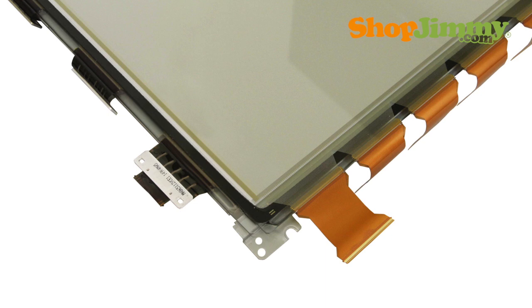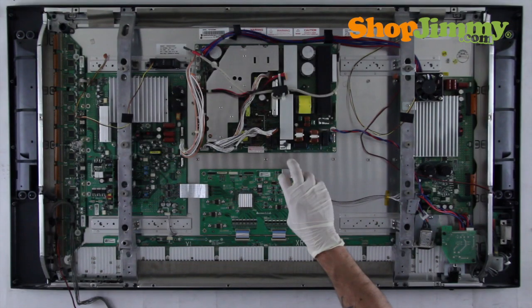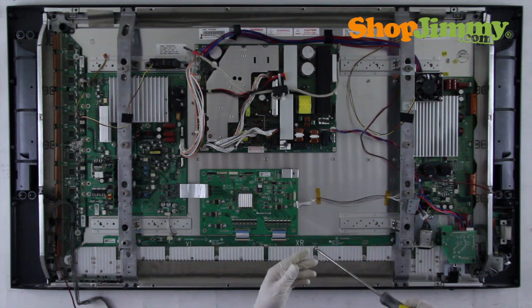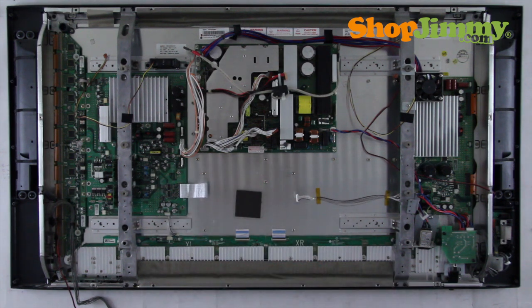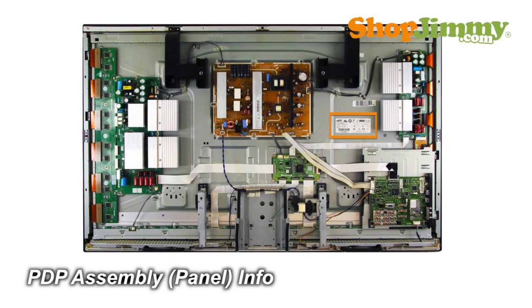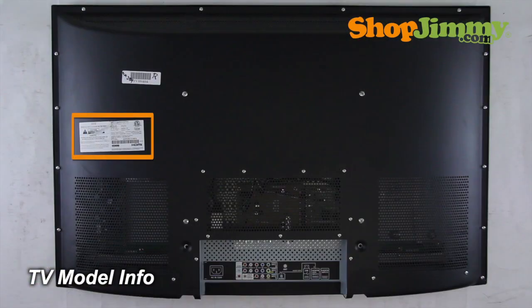The screen is connected to the chassis PCBs via copper and gold ribbon cables. These ribbon cables are permanently fused within the screen and can only be repaired by replacing the entire PDP assembly. While plasma display technology may seem complicated, replacing plasma TV parts only requires a screwdriver and some patience. Finding a replacement screen requires both the panel information found on the identification labels on the chassis side of the PDP assembly and the model information found on the back and/or sides of the TV cover.